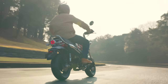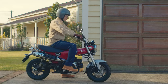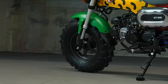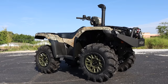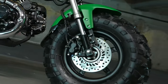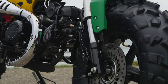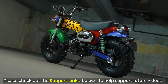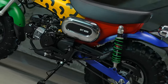The transition from mini street bike to mini off-roader was started by ditching the tiny 120 and 130 by 70 street rubber for these 23-inch tall Carlisle AT489 ATV tires that they were able to shoehorn onto those factory 12-inch wheels. To make this setup work, they had to make some brackets to lift the front fender for a little extra clearance, and out back they went with some aftermarket YSS shocks to help out on clearance as well.